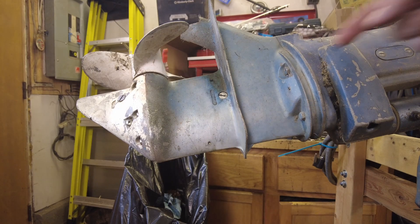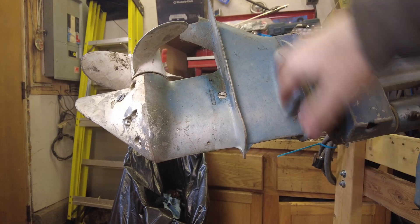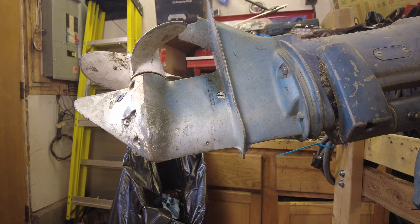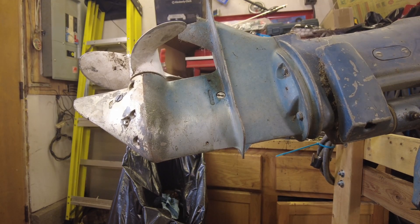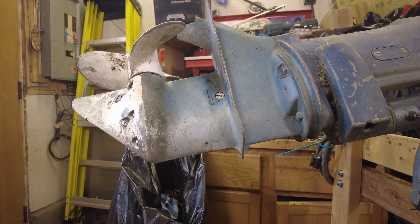Likewise, in the top here there'll be a water pump assembly — I'm going to guess it's probably in this enlarged area right here. I don't know that that doesn't work, but given the age of the motor, it's probably the original water pump, so definitely we will be replacing that. Let me lower this back down. I'll have to go find a garbage can that I can put some water in and give this a little bit of gas and see what it does.